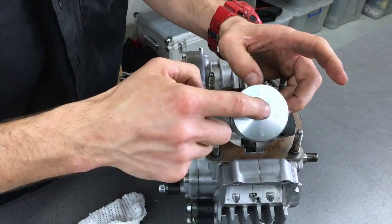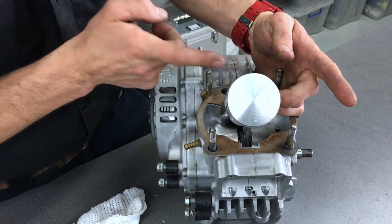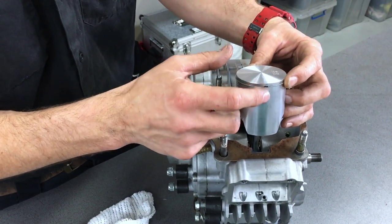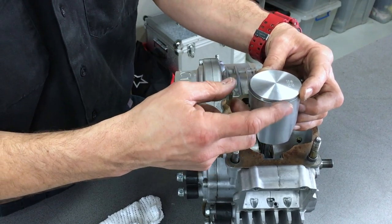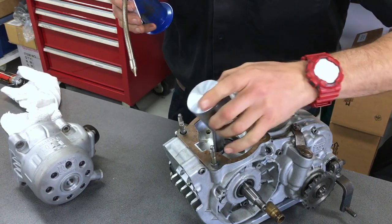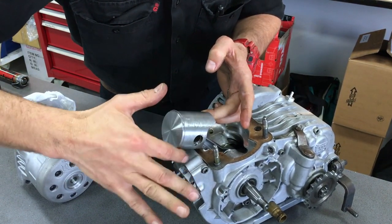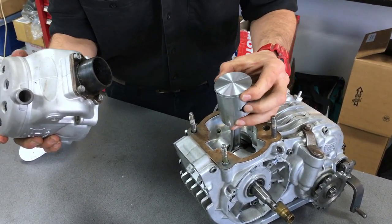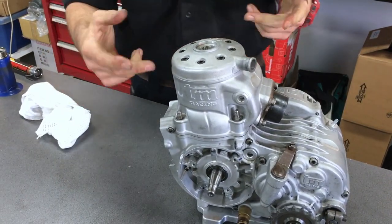On the top of a two-stroke piston there's normally an arrow and it faces to the exhaust port — on these it's the back. Don't forget that; it doesn't face the direction you travel. It's for the exhaust port so that the ring on the two-stroke doesn't grab inside the exhaust port as it goes over the opening. Otherwise if you put it in the wrong way the ring will open up, get stuck in the engine and rip it all apart. So just oil up the piston ready for assembly with a coat of oil — this helps the piston slide back in the bore. Oil inside the cylinder too, then hold the ring in and just slip the bore over the top. Give it a little wiggle — that's it. Boom, we're back on. Now do up the cylinder nuts and we should be good to go.